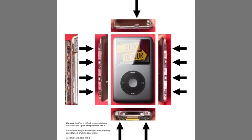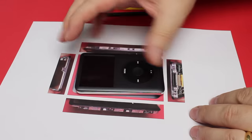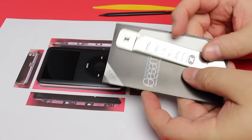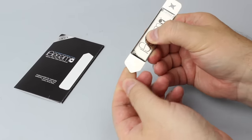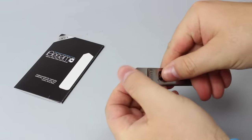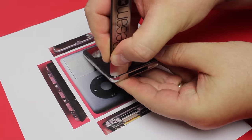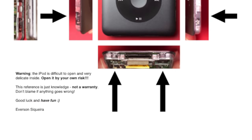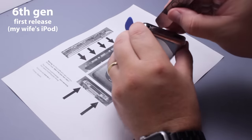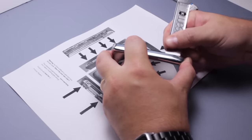Here is what you must know to open the iPod: there are 11 retaining clips. I also made a PDF you can get in the description and print, so you can know exactly where the clips are and disengage each one using the iSesamo tool. The iSesamo is not exactly sharp, but not dull either — the tip has a special shape and the blade gets in really easy. Push it vertically to the bottom on every clip, disarming them. Start with the top clip, then the two bottom ones, then the four clips of each side. It might be useful to have guitar picks to keep clips from gripping back. Be patient and good luck.